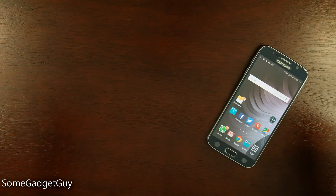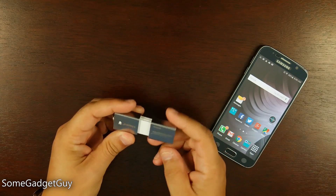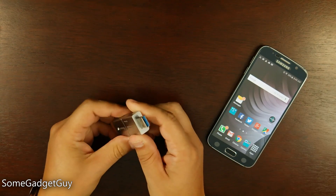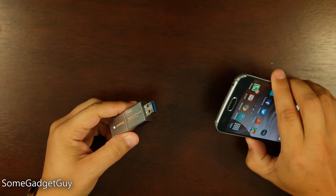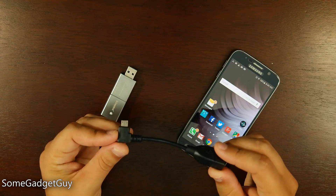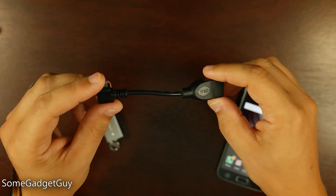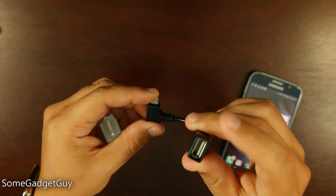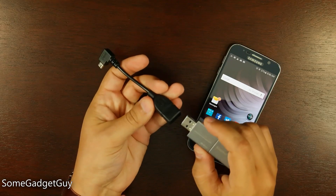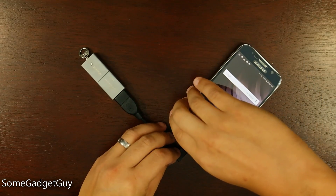Let's say you don't have a memory card lying around and you don't want to invest in a memory card and a memory card reader. Thanks to the power of USB host, you can use a traditional USB flash drive with your Galaxy S6. Of course, this full-size USB port is too large to plug into the micro USB port on the bottom of the Galaxy S6, so we're going to need an adapter. This is what a micro USB to full-size USB female adapter looks like — very simple. This plugs into the bottom of your phone, and this plugs into a USB device. So I'm just going to take my flash drive and pop it into the full-size port first, then line this up with the port on the bottom of the phone and punch that in.